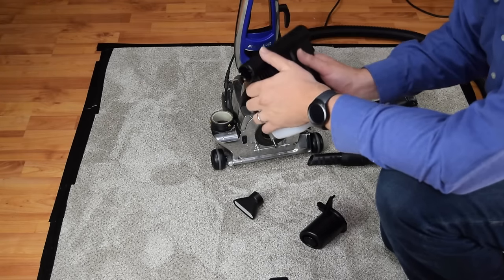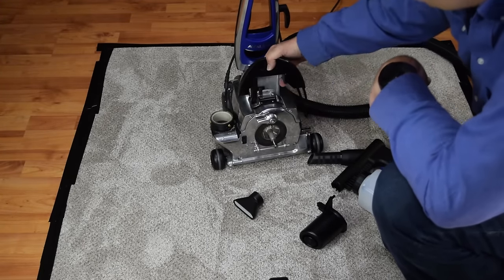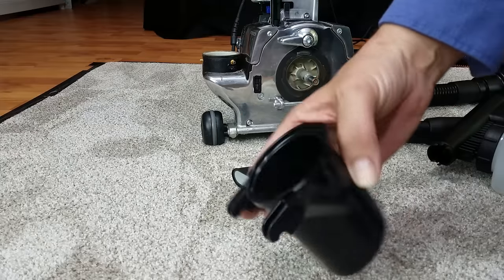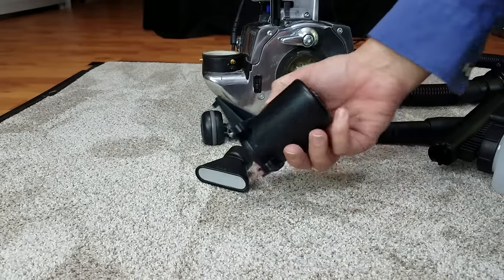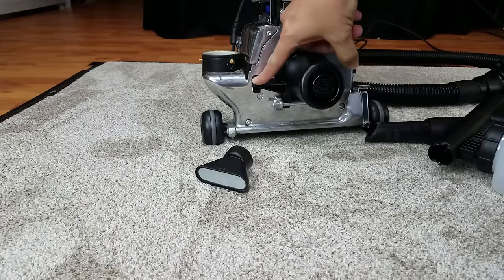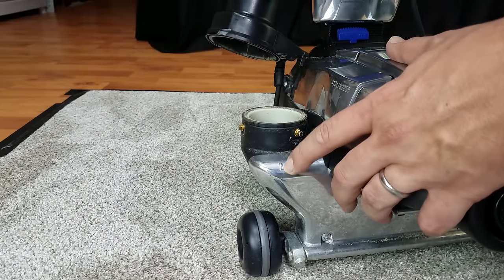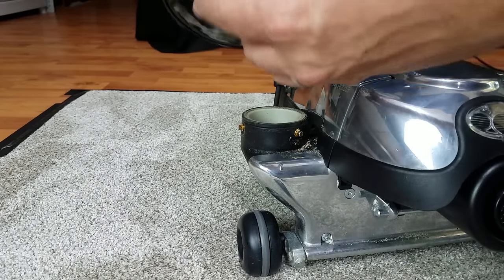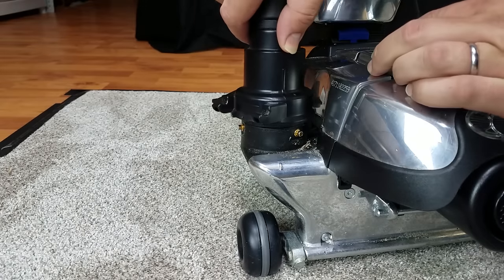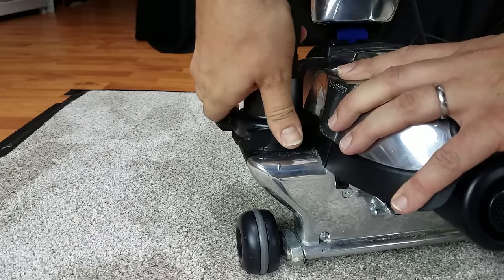To use this, we're going to need to turn the Kirby into a blower. I've already removed the shampoo components. What you need to turn it into blower mode is this intake stopper for the front — it just kind of folds in, and that piece goes inside there. Next you attach the hose to the top part where the bag normally goes. You can see a little notch right there that corresponds to a notch on the hose. You line those up, and then turn it clockwise to lock it.